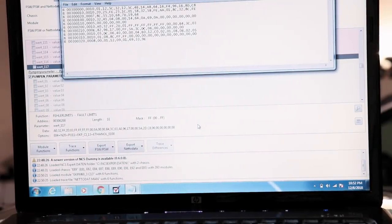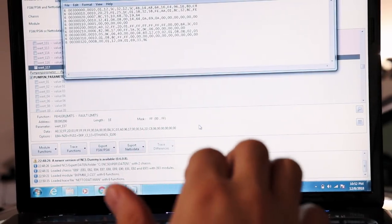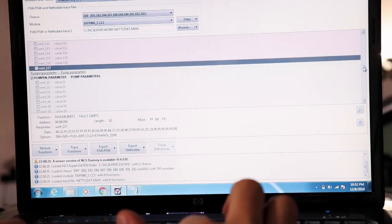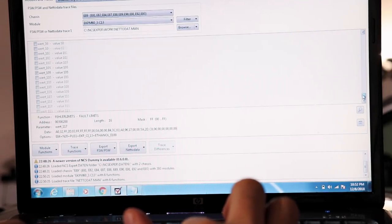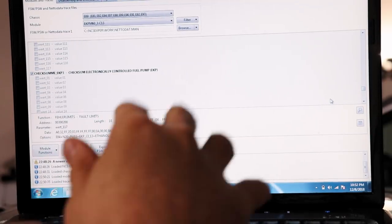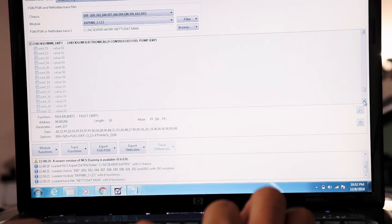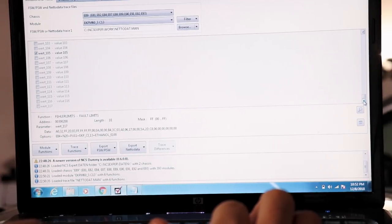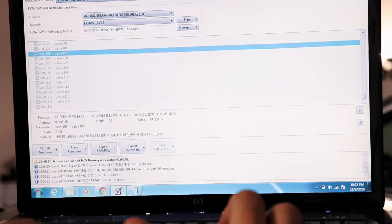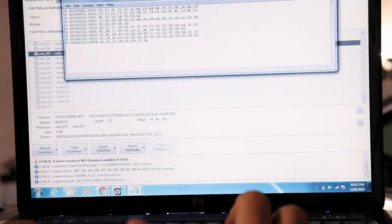I guess you could say this makes for a more interesting video, but I forgot one crucial step. We have to do the checksum. If you go all the way to the bottom here, we have a checksum value. You have to take all that code and compare it against a checksum, they call it. My checksum was 339E, which is right here, 339E.